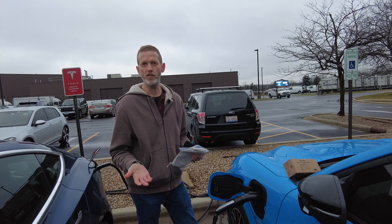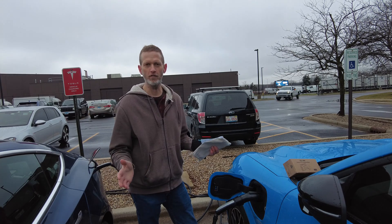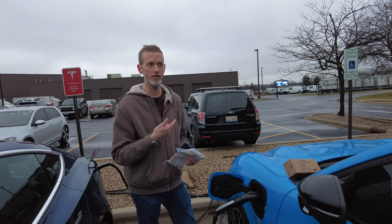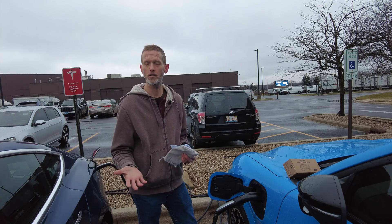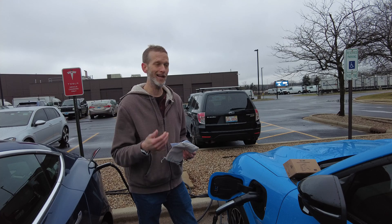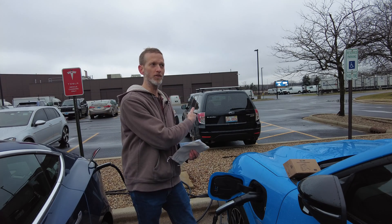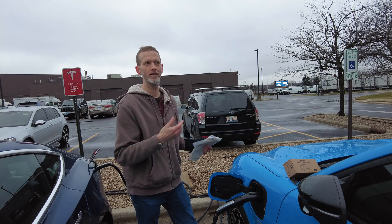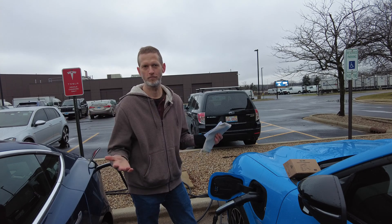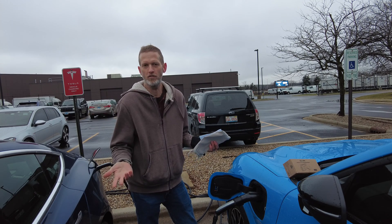All vehicles mode is essentially J1772. All modern Teslas support J1772. I've never run across a destination charger that wasn't set to that mode. But it's possible that they exist, and in that situation this won't work unless you open the destination charger and change the dip switch. Hopefully all of them are set to the modern Tesla charging mode, which is J1772.